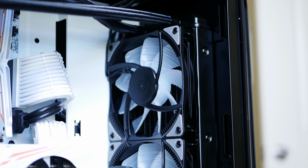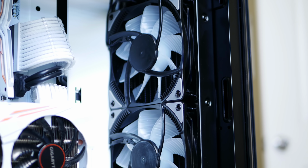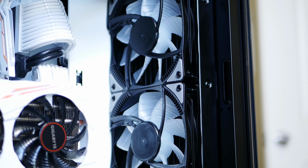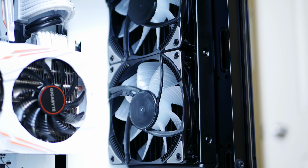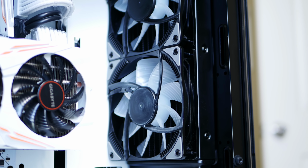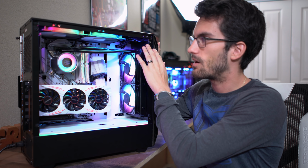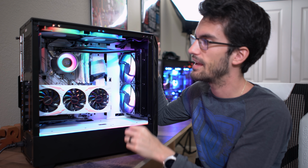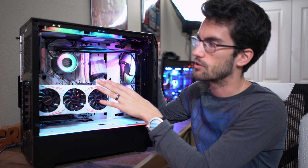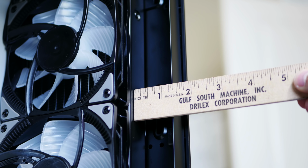And toward the front, you'll find support for up to a 280mm AIO combo, and I'm saying just 280 because there is no cutout in the basement, which means that this chassis does not support 360mm fan rad combos of any sort. You can't fit a 360mm rad anywhere in this chassis, so limited just to 280 up front. I wouldn't even call it a 240 up top because there's just really no vertical space for that. And then you could probably squeeze out a 120mm AIO at the rear, although we'd be really cutting it close. I would recommend putting everything that you can AIO wise up front.